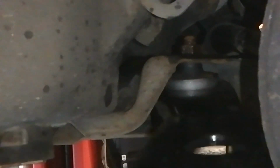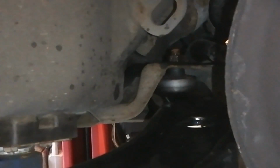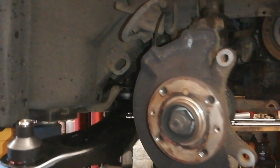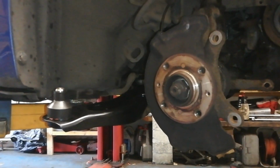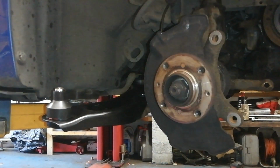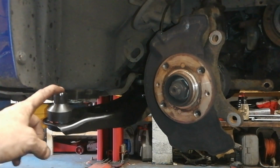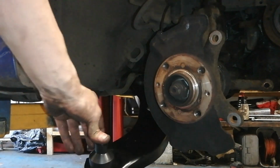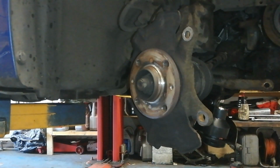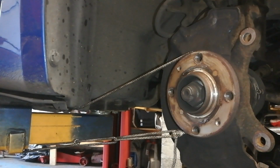So that's just wobbling about there by itself. And we've now turned the steering to the right, so there's a bias on the right. That'll allow the strut now to move backwards, back that way. So we just put a wee bit of force on that and slide it under the strut to come around to the rear of it, like that. So with the steering wheel to the right, I've tied the strut back to the ramp